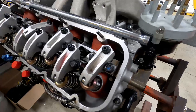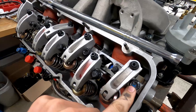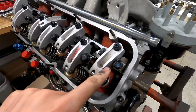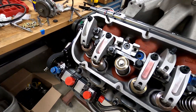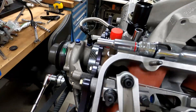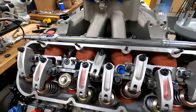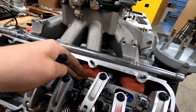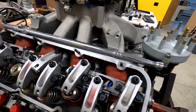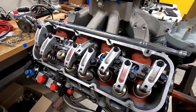I've got a little bit of an issue. As I got done putting the intake rockers on, I noticed all the studs holding the intake rockers are too short — we've only got about a half to three-quarters of a nut worth of engagement on all of our intake rockers. I got some new studs that came in, they're about 300 thousandths longer. You can see over here, this is one that I fixed and it's actually got the studs sticking out properly now. Basically what happened is we used the studs out of the old heads, and the boss that the stand sits on is not the same height, or the holes are drilled to a different depth. Anyway, that's the fix — I'm going to get all those swapped out on the intake rockers.